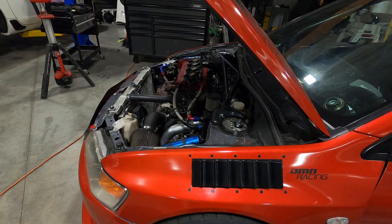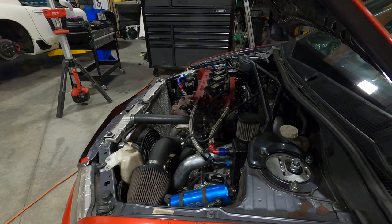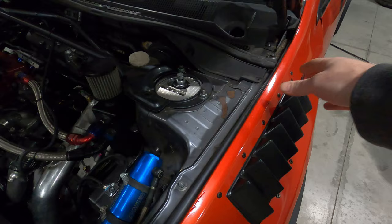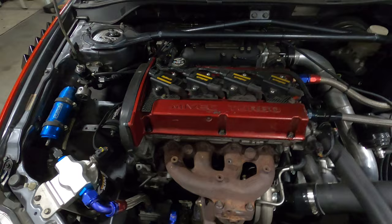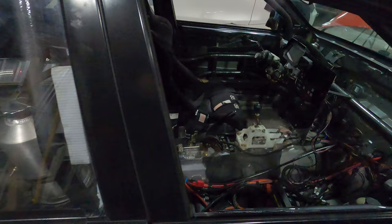One thing I wanted to take care of was weight savings up front. The Evo is basically a front-wheel drive car with all-wheel drive added on, and the center line of the wheel is actually behind the engine, so it's very front-heavy. Anything up front I could move to the back, I tried to do. Most of the stock wiring, the fuse box, is underneath the dash right by the driver's feet — the heaviest part of the car. The main harness came through the fender, and the engine compartment fuse box was right there along with the battery, so we moved all that back to where the ECU is and relocated the battery to help with weight distribution. We also removed the power steering — probably 15 pounds of pump, lines, and hardware — and relocated it to the passenger compartment.